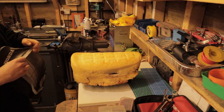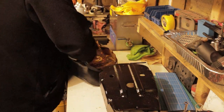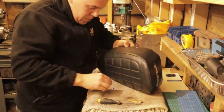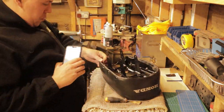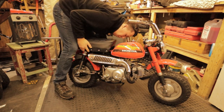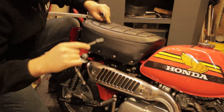Please don't be fooled into thinking I'm any good at this or have done it before — this was my first time. With a bit of patience it's very easily done. These seat covers fit extremely well, and as long as you take your time and make sure you've pulled the material tight you'll have no issues. It's a great way to finish your bike nicely — a seat cover for £40 makes a massive difference. We stretched the material over and hooked it around onto the seat base frame where small pointy tabs stick out, put the pins in the sides, and done. From that point we can put the seat straight into the bike and bolt it in place — which actually is one of the final things to be done.